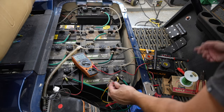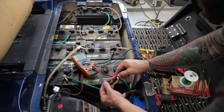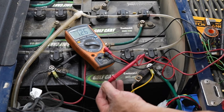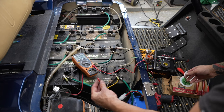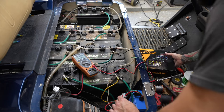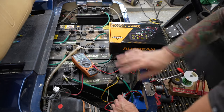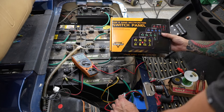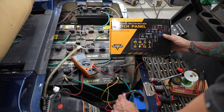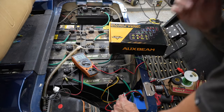My reducer now should be 100% functional. Got the meter hooked up — shows no volts with the key off. Turn the key — now I have 12 volts. Now I can power anything 12 volts with this wire. What we're going to do next is hook up this switch panel, which is going to give me relays for all my future installs and all my lighting, radios, everything I ever want to do.